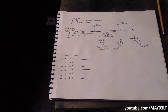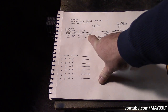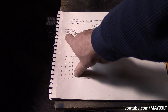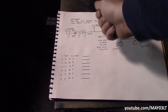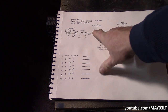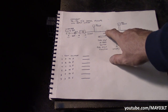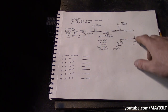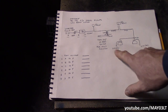To keep things DIY-friendly, we're not going to use the OEM schematic because reading those can be a real challenge. I isolated the schematic to show only the low beam wiring. The low beam circuit goes from fuse number 8 in the underhood fuse block, through a connector, through the headlight switch, then to a DRL module. Those wires are spliced together, then it goes to your high beam switch — the stalk — up to a DRL relay, then down to a splice where the left and right low beams are joined, each with their own independent ground.